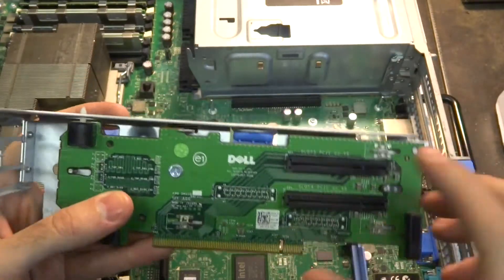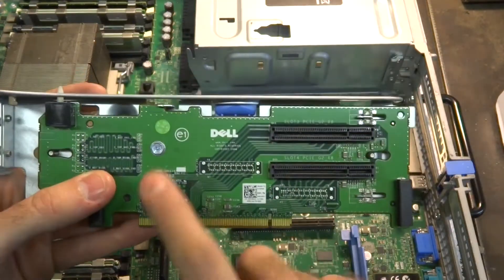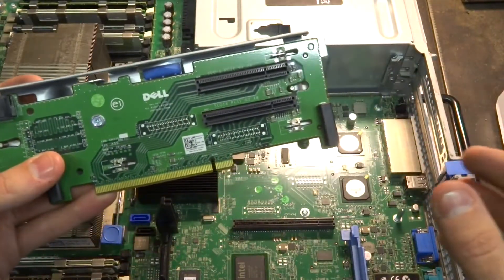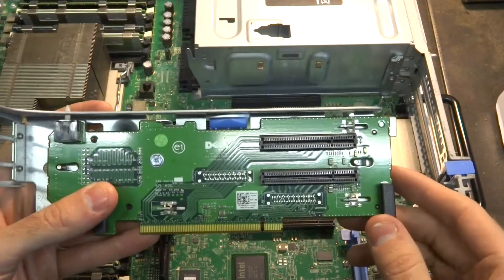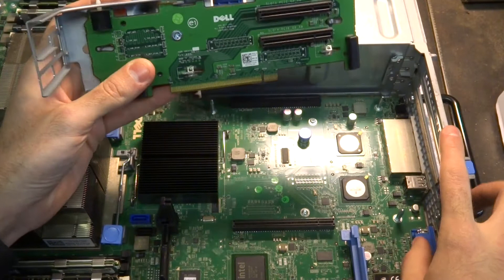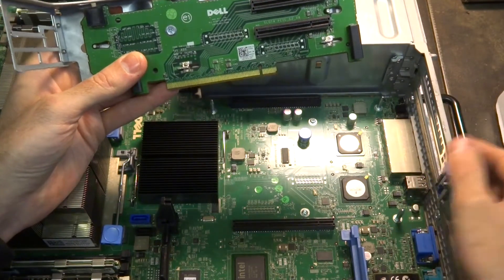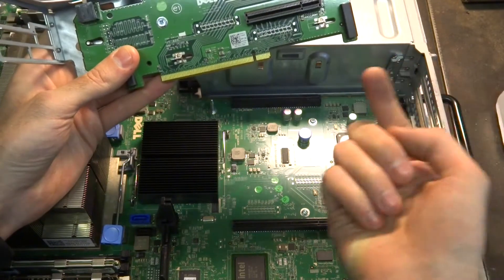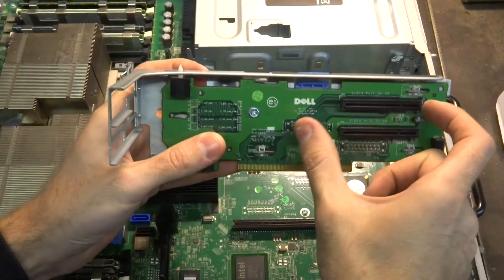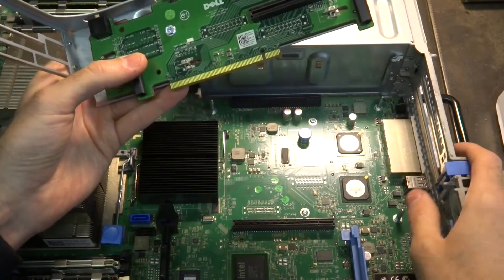Or if you don't fancy doing that, you can get a replacement riser board which is X16 to X16. However, for some reason the X16 slot is on the top, which doesn't make it entirely useful for a graphics card, because these PCI slots are the other way round, or upside down, compared to conventional desktop cases. So you'll have the fans on a graphics card pointing upwards, and because the X16 slot is at the top, you can only have a single slot graphics card, which is rather annoying.